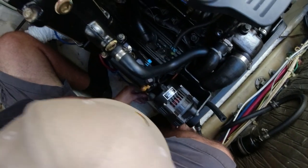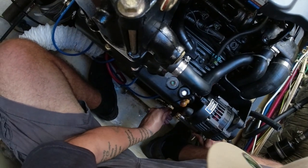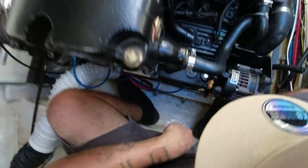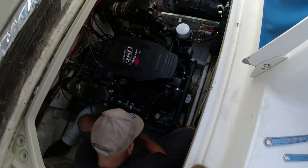After you're done hand tightening the fuel filter, next connect both fuel lines to the new fuel pump. Then just press the new fuel pump into the bracket. Reconnect the fuel pump plugs and turn on your batteries. And now we're ready to restart the engine.